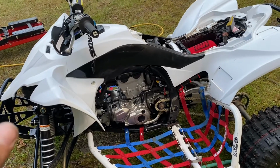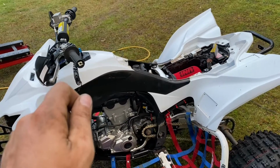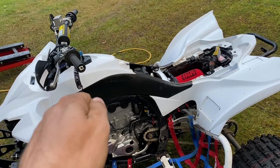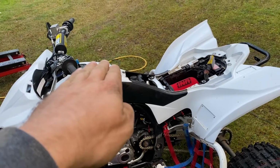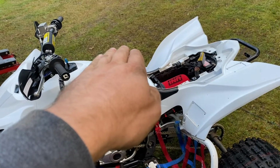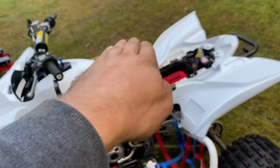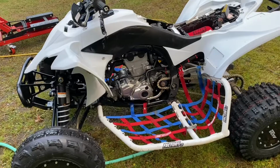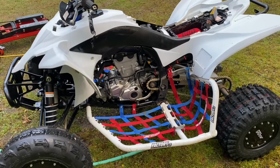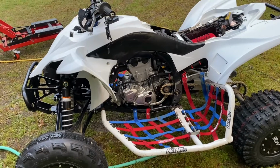you want it to run, if you're sitting at idle, you want the knob to be just like a carburetor. You want it to sit right before it starts idling up. So if you're flatlining at an idle, right before that curve up, you want it to sit right there. Any lower than that, you're getting less air than you need. Any part where it's starting to go up, you're getting more air than you need. Worst case scenario, even if I go race it down in Mammoth or somewhere south, I'll have to adjust the idle screw maybe out a click or two, and that's just to give it more air or less air.